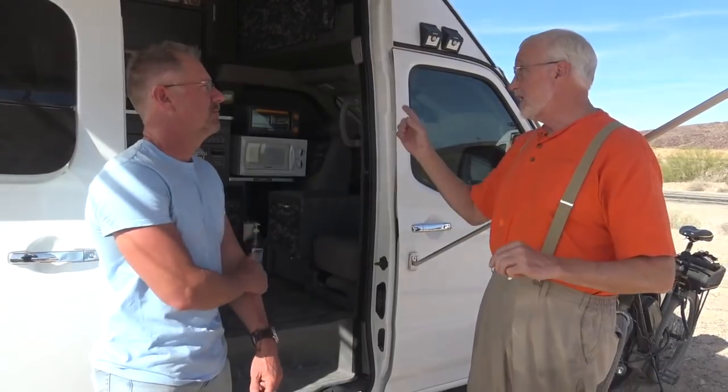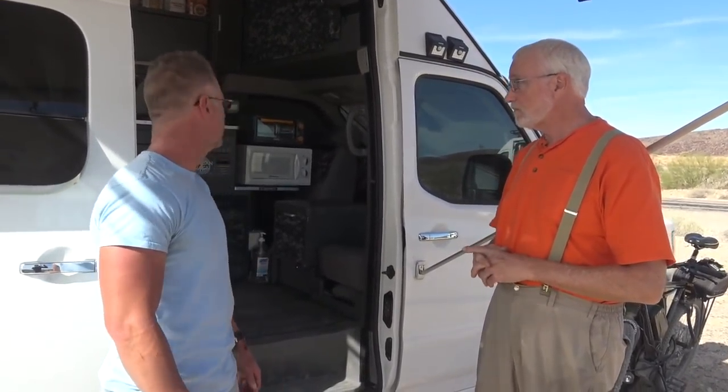The galley cabinet is 70 inches — all one piece. 70 inches wide, 24 inches high, 12 and a half inches deep. It weighs 35 pounds. I picked it up, put it in, and bolted it in there myself. Is that airplane birch? Birch plywood and birch hardwood. I like birch because it's strong and light. It's not quite as strong as oak, but it's a lot lighter. It's not quite as light as pine, but it's a lot stronger. So birch is a good choice.